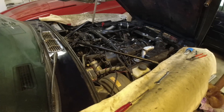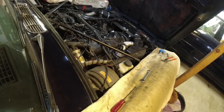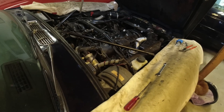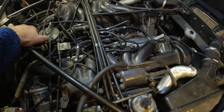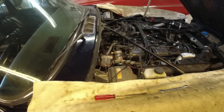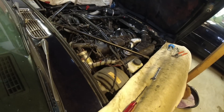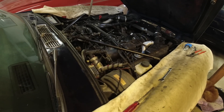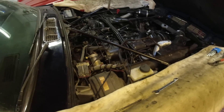Timing is set now at 10 degrees. It idles a bit too low, but the next thing we're going to do is tackle the carbs. Everything is a lot better than it has been the whole time. Let's just fire it up. See, it's just instantaneous - really good throttle response, and it's not even warmed up yet. I've turned the choke off just to have it down at idle. Give it a little bit of choke - you can see it's really, really a happy camper.